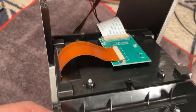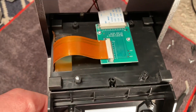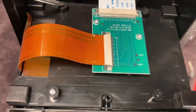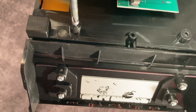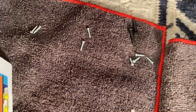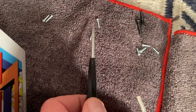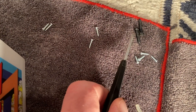Take that screen down - you can see we've got plenty of ribbon here. You can push that back into the cabinet to support it. Then we'll have four more screws to take out. Remove this one, this one, this one, and this one. I'm going to show you what it looks like when we take the lens out between the bezel and the LCD. These screws are: the lower back cross brace that holds the LCD, the back that holds the power switch and volume control, the two main back screws, and the four screws that hold the LCD.